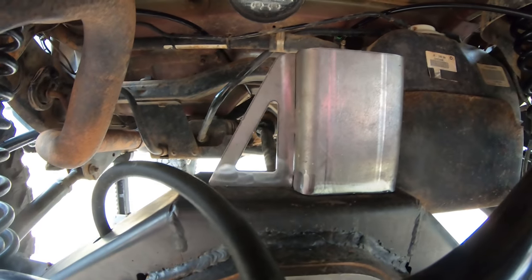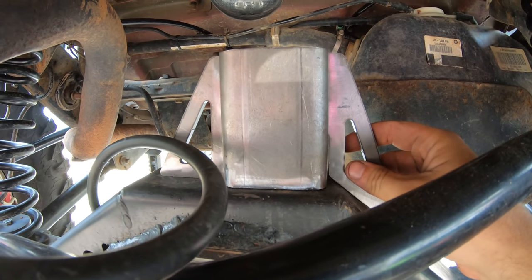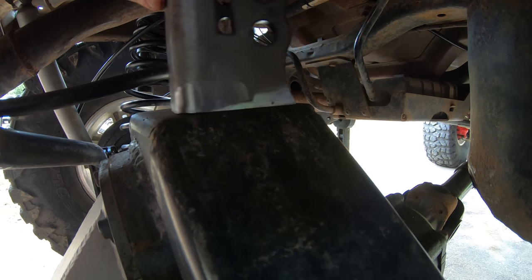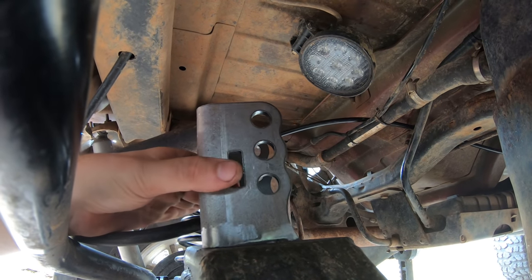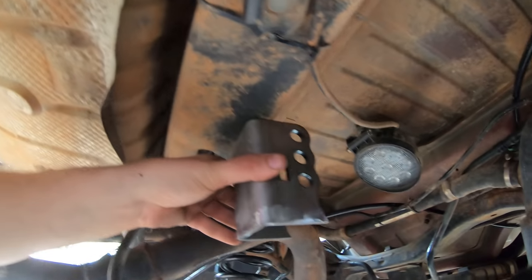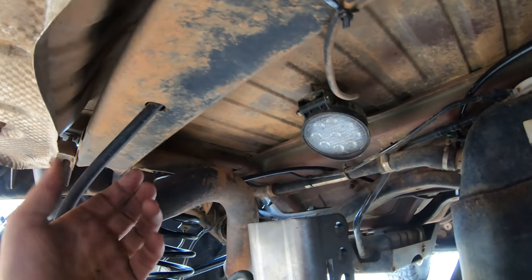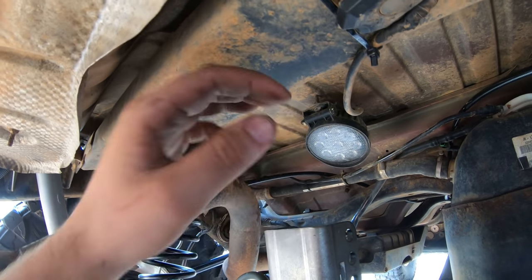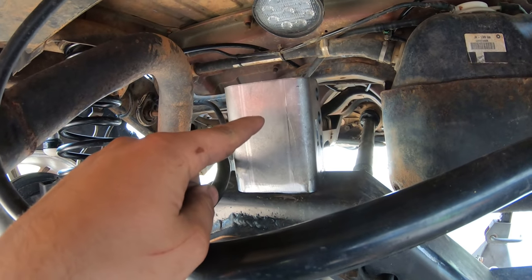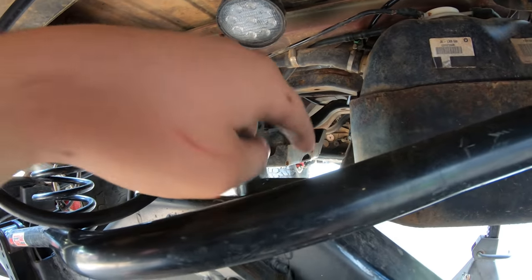We also need to make sure we have adequate distance. If we weld this too far back, when the axle comes up there's a cross member back here and you don't want to hit that. If you're running a super-low center-of-gravity build, you can notch a square and weld a plate up there so the bracket has no issues traveling up and back. We're going to align it with the gussets, tack it in place, remove the gussets, and then weld it.